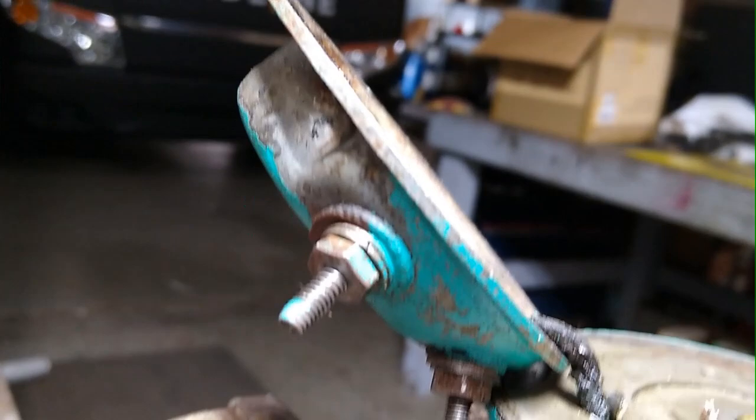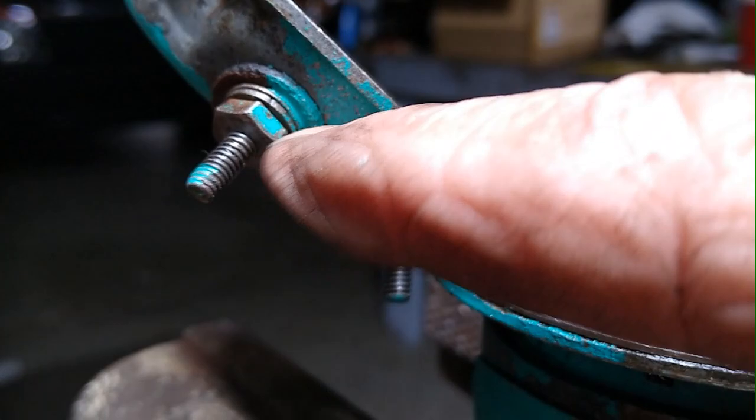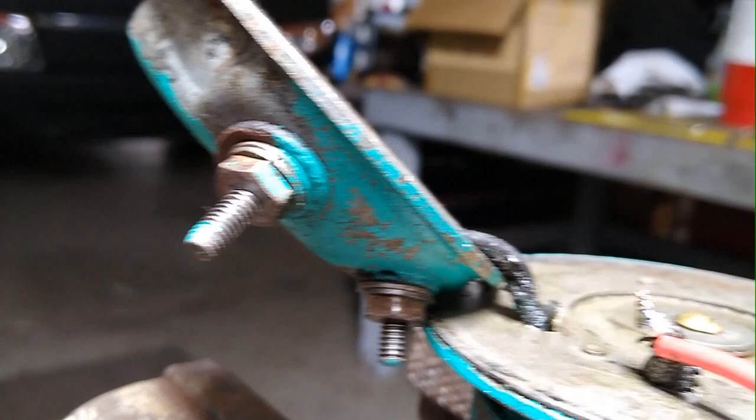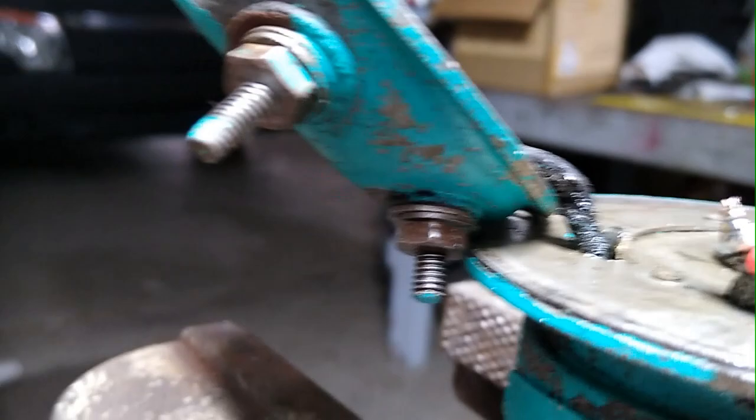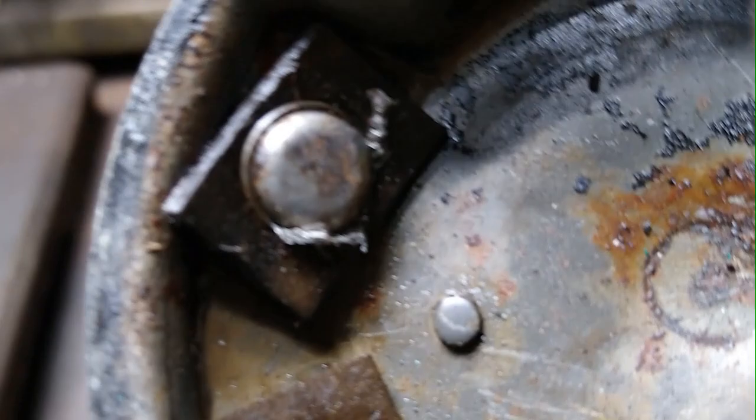What happens is, if you're not watching, and let's go back to what I've been saying, you need to tighten all these nuts down. Remember when I said you remove the top nuts, the wire, whatever else, and get down to that bottom nut and tighten that nut down. Otherwise, when you go to tighten the upper nuts or loosen them, you see paint on this, preventing that nut from spinning right off with your hand, right? So what happens is the whole bolt is turned, and back around on this side, you've twisted the wire going down into the coil.